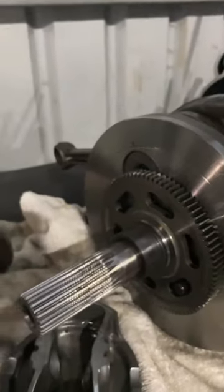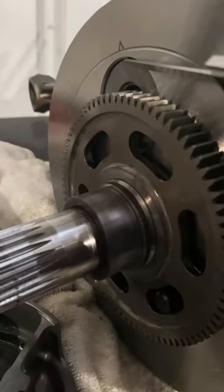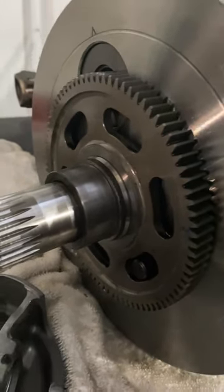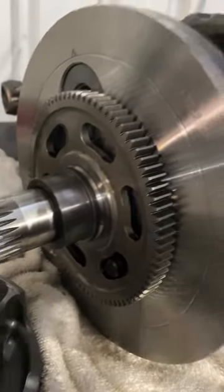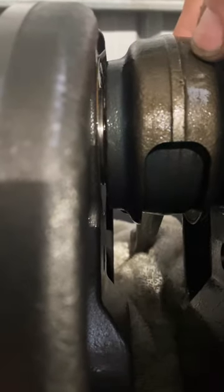That twist would have broken at some stage. Now on the crank pin, we are two millimetres in the hole — two mil, that's 78 thou. So this has started walking itself. This is where catastrophe gets real — it's already happened. There could have been even more going on. It's walked the rods themselves. Just remember, we've got nearly two millimetres of walk — absolutely savage.